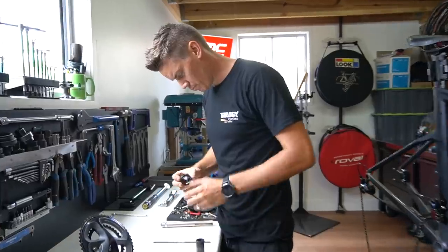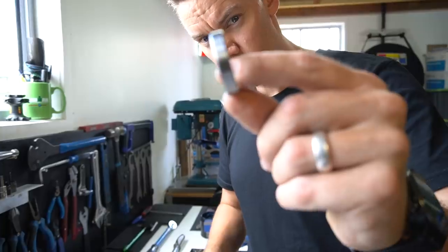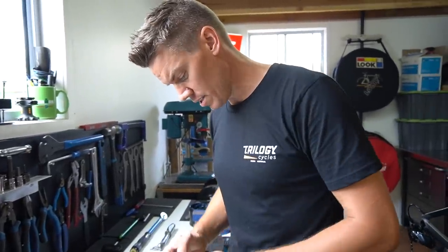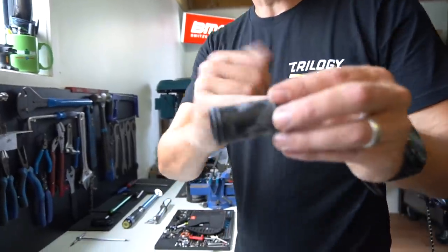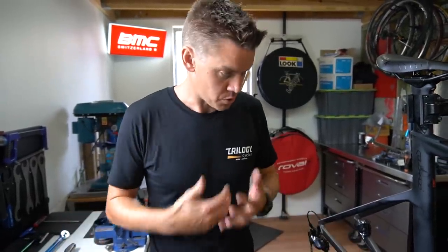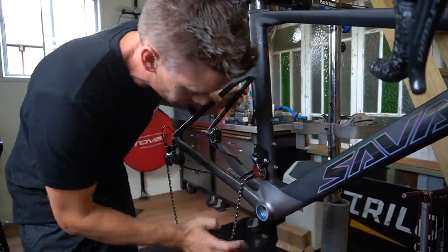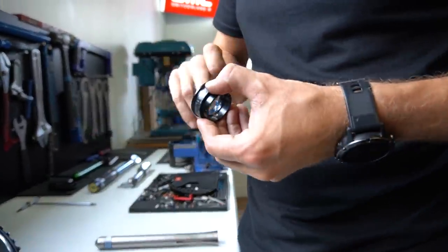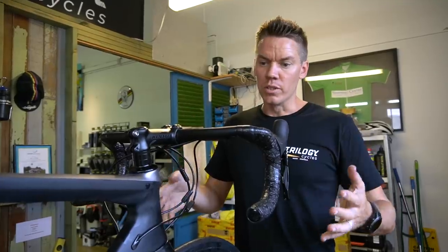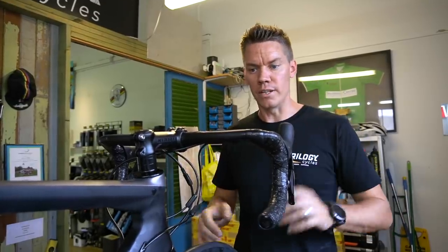Extracted the bottom bracket — it's bone dry. We've got an aluminium cup and you can see the marring on that. The other one's bone dry too. Being bone dry, what's that going to do while you're riding? Creaking. Everyone blames the poor bottom bracket, but we find a lot of the time it's not the bottom bracket — it's other things. In this case it would 100% be the bottom bracket because it's just powder on it. This is running an aluminium shell, so what we do is rebuild the assembly, press it all together. Sometimes with aluminium face shells we actually face the frame to give it an absolute parallel finish. Some of these bearings are pressed in with a bonding agent, but in this case they just fell out. We've now got a uniform finish all the way around the cup and a greased bottom bracket shell.